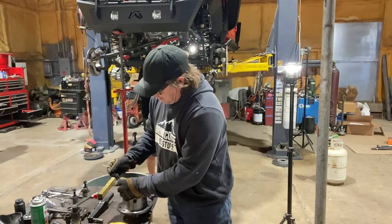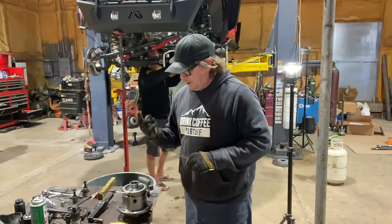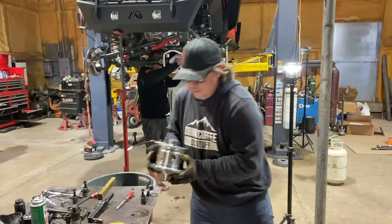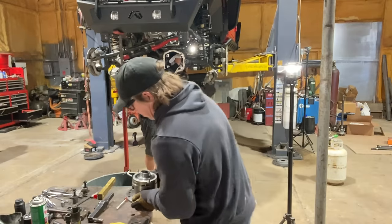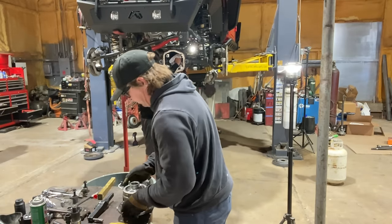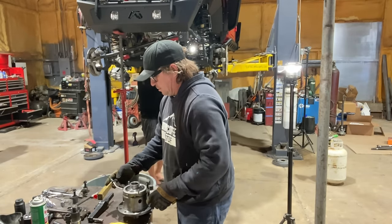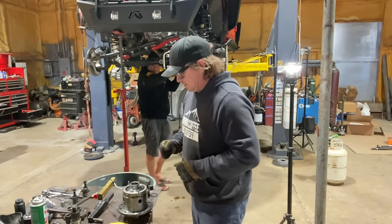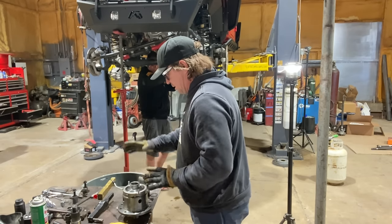It does have to have a hole drilled in the housing so that the wires can go out. They will go through this grommet that's right here on the wire, so that will seal up any leaks, but we'll have to read the instructions and figure out exactly where it wants that hole drilled. And then make sure we do a clean job so we don't get a bunch of shavings inside there. So I'm going to clean this up and clean up the ring gear and get ready to assemble this.